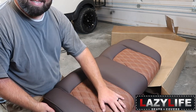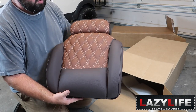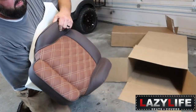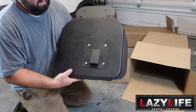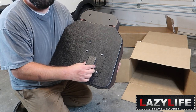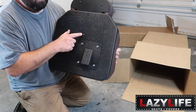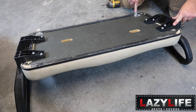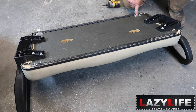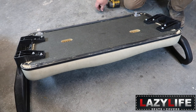This is a good looking seat. Here is one of the seats — this is the driver or passenger. This is the other one as well, on the opposite side. One is already for the passenger side, one is for the driver side. You have the spot for the mounting load bolt there. On the handles, the hinges take a 7/16 socket to remove — two from each side. The handle bolts take a 3/8 size socket. We need to go ahead and remove those.